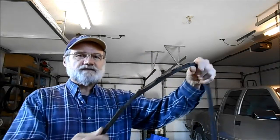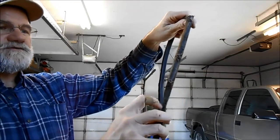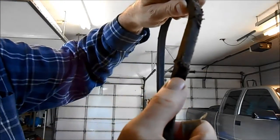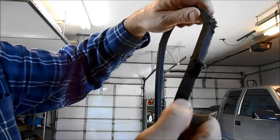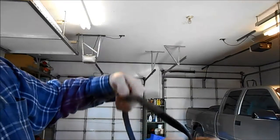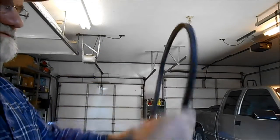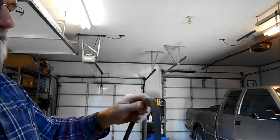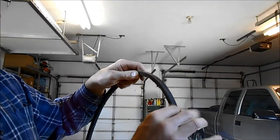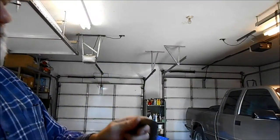This is just a little look at the belt I took off. You can see it's chewed up. If you look real close, you can see where the pulley was digging in, moved forward and dug in again, and burnt right through. I did get the tiller to spin with this on there, but it was pretty clunky and had a lot of vibration because of that chunk being missing. It's in really bad shape all the way around.